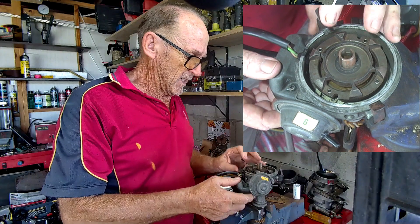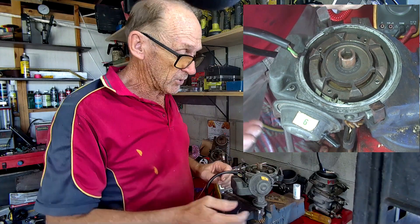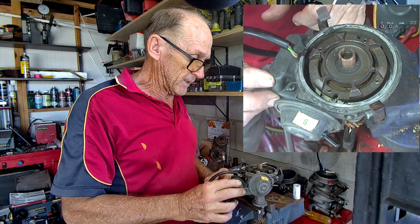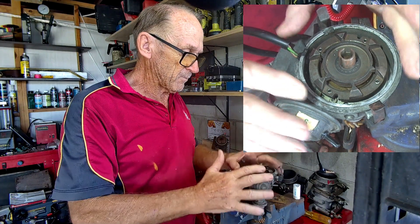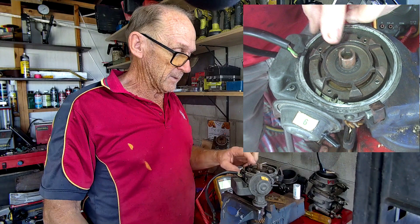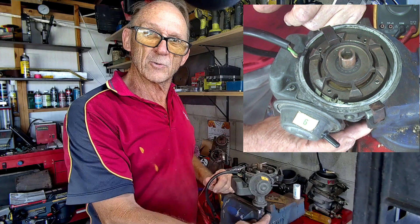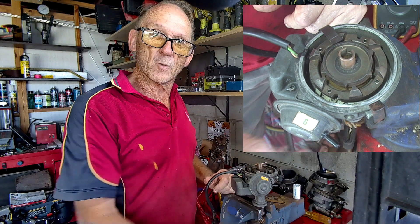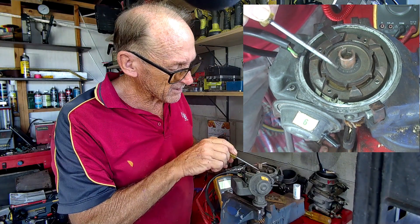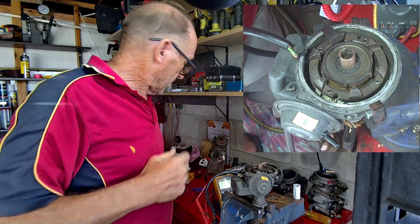We did the module in part one. You can do this in the car - you'll probably have to rotate the distributor to get at the back vacuum advance screw to remove it. One thing you have to be careful of is that clip. Because these are magnets, the clip tends to attract itself there. If it gets into that position and you rotate the engine, the trigger wheel will hit, jam, and shear off the pin fitted underneath this little circle.